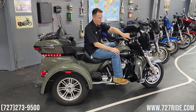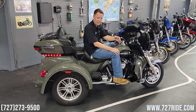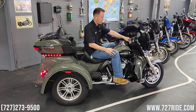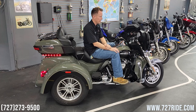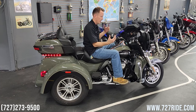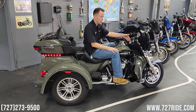Your hazard button is one that will confuse a lot of customers who have been on Harley for a while, because the start button has predominantly just been the start button. On this machine, the top side of the start button is your hazards. If you turn the bike off, the hazards will stay on, and pressing the button will not turn them off. You have to turn the machine back on and then hit the hazard button again for them to go off. So if you hit your hazards and shut your bike off and wonder why you can't turn them off — the reason is your bike isn't on. You need to turn the machine on first.